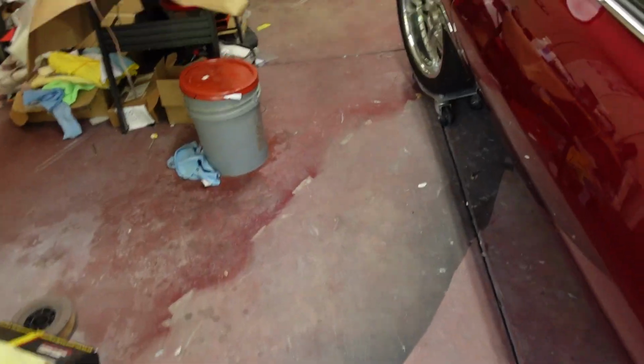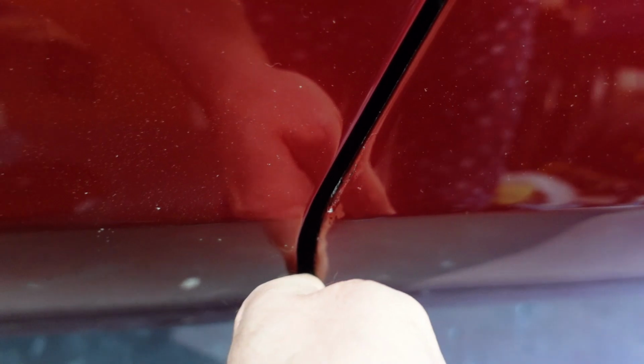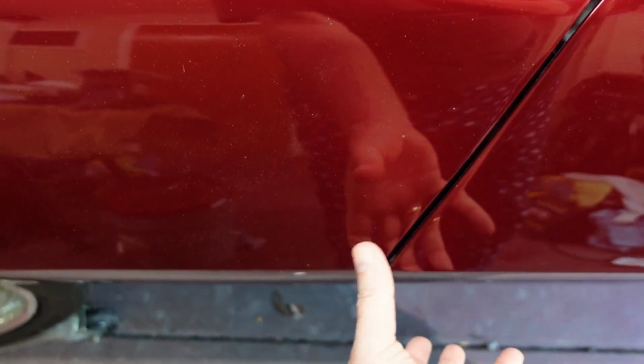And then the other thing is the door here where I tore the paint off. We're going to look at this and see what to be done about it. I put the little touch-up paint on here and you can hardly tell anything even happened. But I'm probably going to sand this back a little bit. And then when we paint the bumpers, I'll just take a paintbrush and dab some paint in there, and clear coat especially, to just seal it. You can see here where it's pretty jacked up. But I do not want to take that around that corner at all, because I don't want to spray any of this and then deal with all of that crap. So I'm just going to do a hack job repair on that, but just seal it so water and stuff can't get under the paint. That's really all I care about, because you can't really see it. That's it. We're going to get to work.